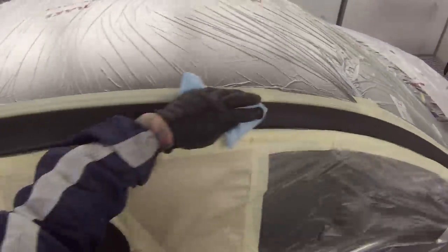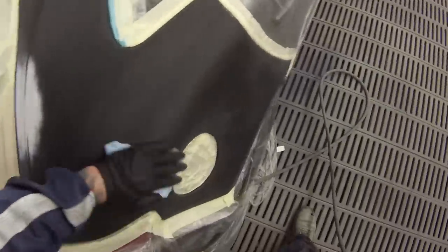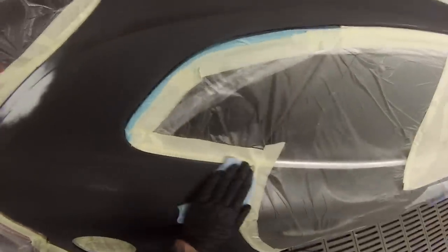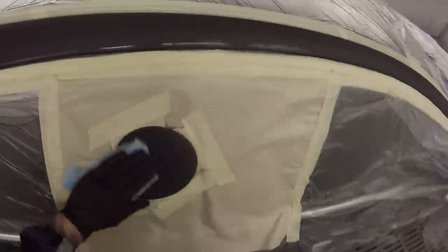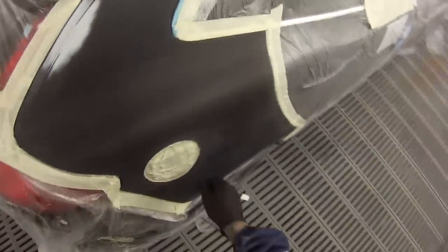Next up we're going to give it a good tack cloth. You can use the yellow or the blue tack cloths — it's up to you. Those who watch me quite often will see me using yellow tack cloths a lot of the time, but then sometimes the blue ones. Part of it is I just like to change it up. If you see me tack ragging my base coat, most of the time it's going to be with the blue one. Not all jobs need tack cloths after base coat — colours with a lot of coarse metallic can sometimes mess your blend up if you clear over coarse metallic that's turned into dust on the blend area, so sometimes you actually have to tack cloth it off.